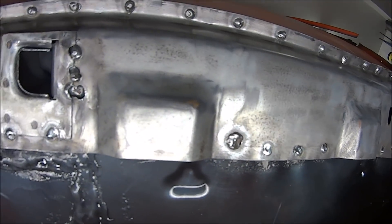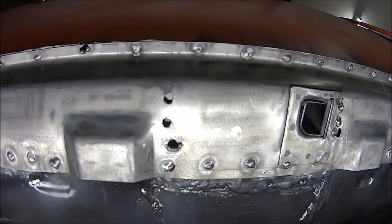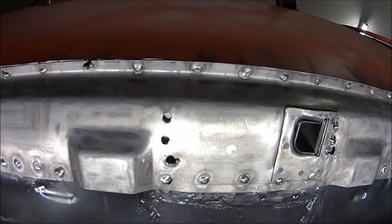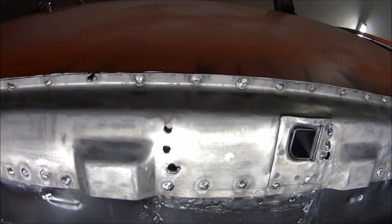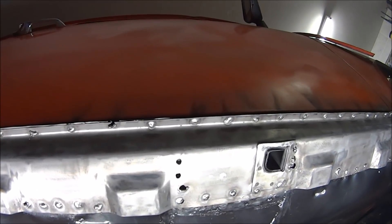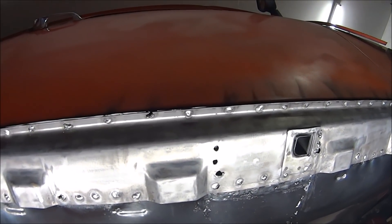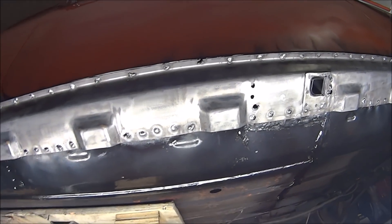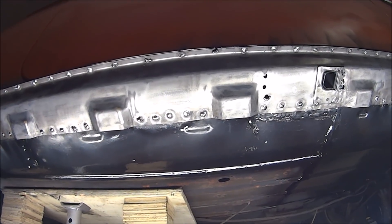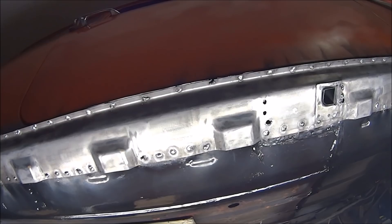But it's in. I need to clean it up and there are a couple of holes that don't quite line up properly - I need to pull that panel back in towards me a little bit. This is where tech screws are really good, but I didn't get around to buying any and I wanted to get on, so I just kind of pushed the panel to where it needed to be and then welded. Well, it's in. Solid.